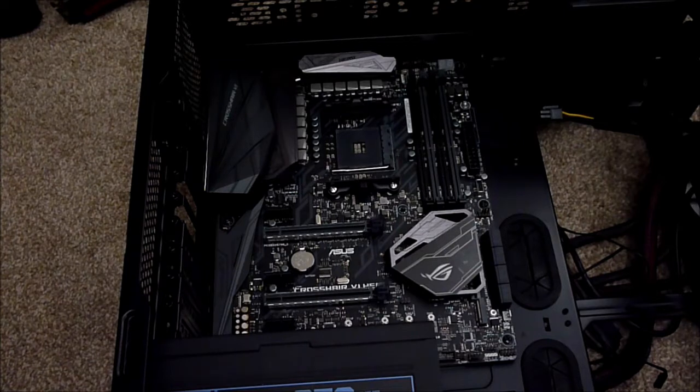To be honest it wasn't as straightforward as I thought, although the build quality of the board is probably the best motherboard I've ever had. The back plate is quite padded and shielded, and what I found is I must not have pushed it in firmly enough — when I tried to put the board in it was springing the board back out. So I had to take the board out, make sure I really went to town pushing the back plate in firmly, and the second time it was a little easier. You have to almost force the board against the springiness of the back plate.